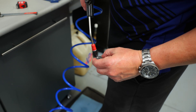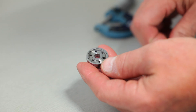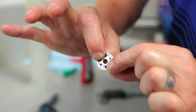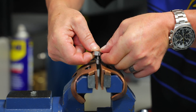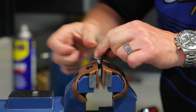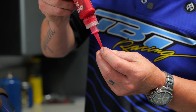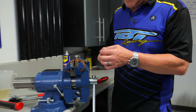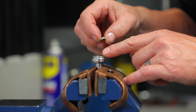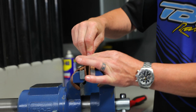With the piston clean, take the bent washer and the check plate, pinch them together, and install it directly down — then just flip your fingers out of the way. Put a little dab of Loctite in the nut. Always put your Loctite in the nut because the extra will get forced out. If you put it on the threads on the shaft and then put the nut on, it'll force the extra into the piston, which is no good.